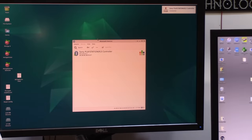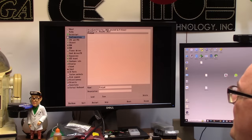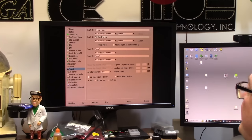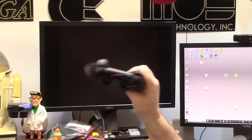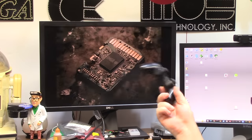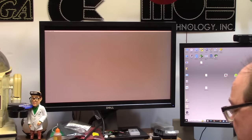Now, when I launch the Pimiga 4, or other interface, I can just press F12 when it loads, and under input here, I can drop this down to PS3 controller. See? And then I will just go configuration, save, resume. Now my PlayStation 3 controller is always connected to Pimiga 4 if it's turned on before this loads. And then I can simply play games and use this as the controller in whatever setup I want.